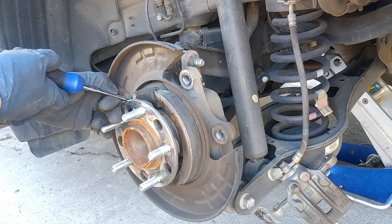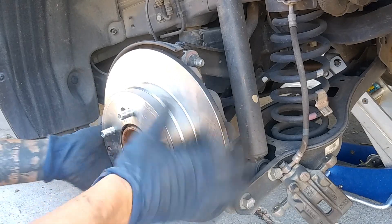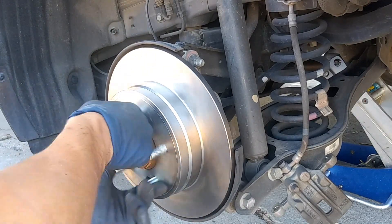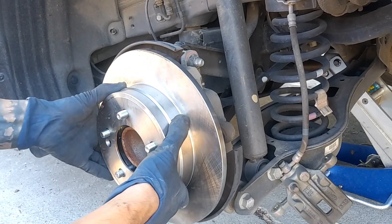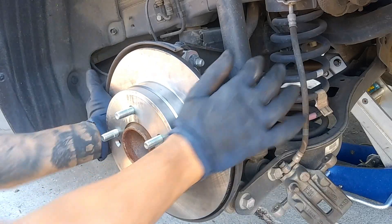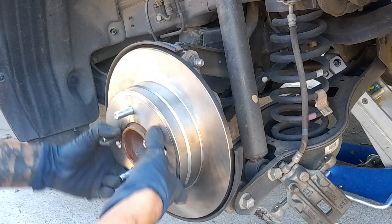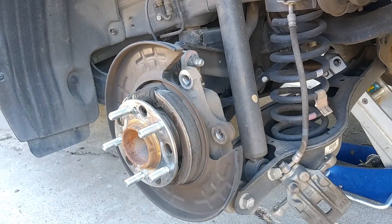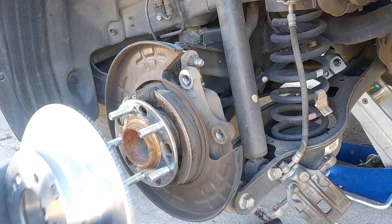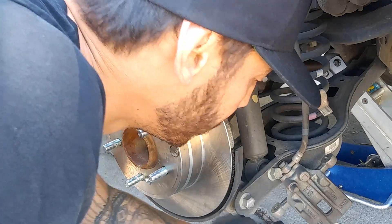We're slightly adjusted a little bit more. You want to make sure the drum still spins freely. It's in there pretty snug — that's actually pretty perfect right there. We're probably going to back off maybe just one tooth, and then we'll call that a day.